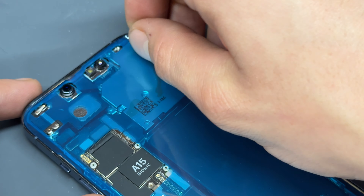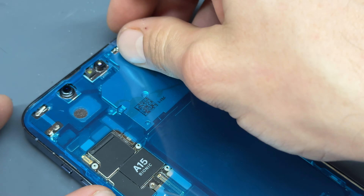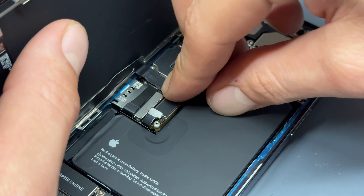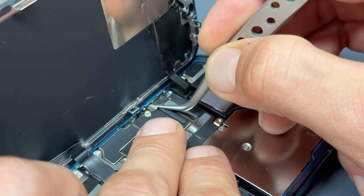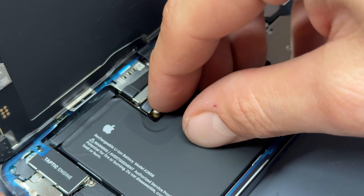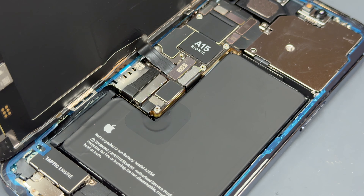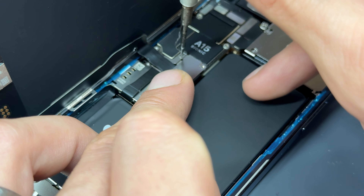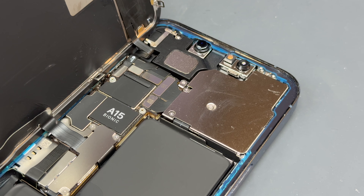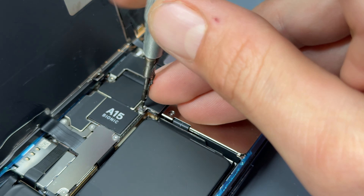With that installed this is now ready to reinstall onto our chassis. The first thing I'll do is remove this first layer of the dust and moisture resistant seal. Bring back the trusty mug to lean the screen on, then offer up the display connector first, reconnect the proximity sensor cable, and then finally reconnect the battery connector — there are also three tri-wing screws that hold it down.